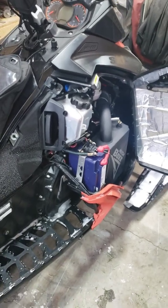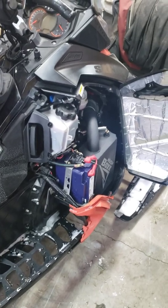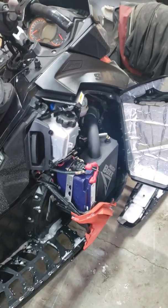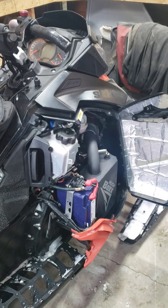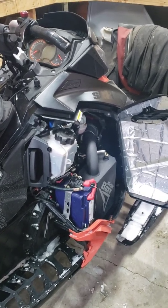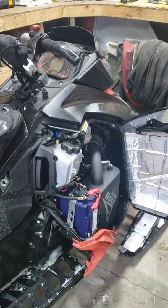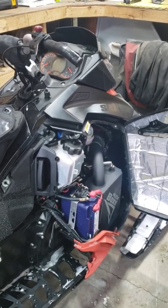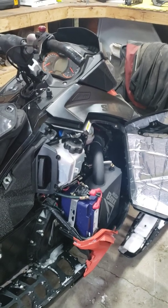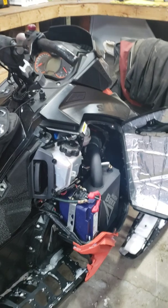You're still better off with a normal AGM sealed lead acid battery. Or, if they start making them, lead crystal batteries, which are very well performing in cold weather. They're very expensive and don't save you anything with weight, but they have very good cold weather performance in terms of getting a lot of amperage out of a very cold battery.